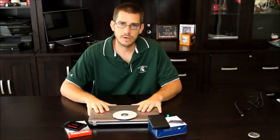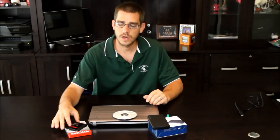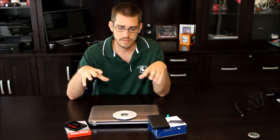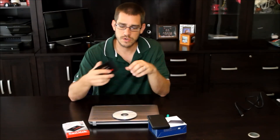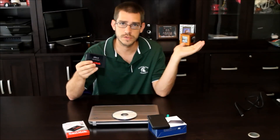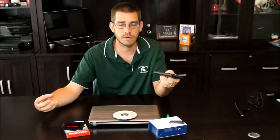I'm working with a laptop here. The process is very similar for a desktop computer, except you'd be working inside a desktop tower. You can also do this for an all-in-one computer. You'll need a solid state drive — you can get any size you want. This is a small one, 120 gigabytes. They go up to a terabyte or larger, just depends on how much money you want to spend. I got a very small solid state drive because I'm going to use the hard drive that's already in this laptop as an external hard drive for all of my data.